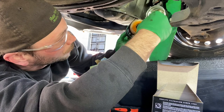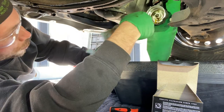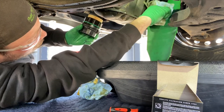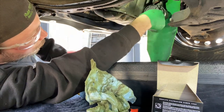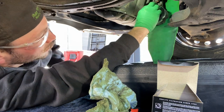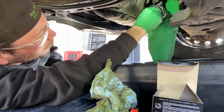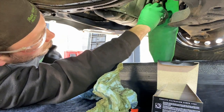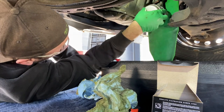Not doing regular maintenance is the biggest way to make your vehicle unreliable. Let's get this o-ring on — it's nice and coated with some oil. It's always important to have your o-ring coated with oil. If you have a metal oil filter, just dip your finger in the fresh oil and give it a light coating — it makes removal easier as well. Get the paper oil filter in there, ready for reinstallation. Give it a quick wipe so there's no oil past the o-ring section, otherwise it'll look like there's a leak.